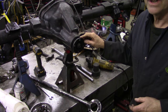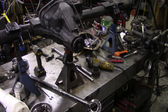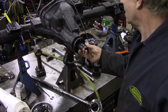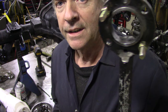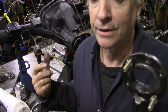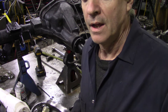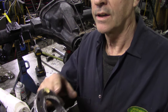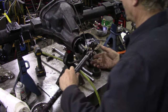Now we've measured it, we're going to take the nut off. To get the nut off we're simply going to use the airline and the impact gun — 32-millimetre socket. You really need something to hold that flange because you will never hold it with your fingers, and it's not really wise to use vice grips. This tool is a flange off a gearbox that I got JP to turn down and then welded onto a tube — really easy because the bolt pattern is exactly the same.